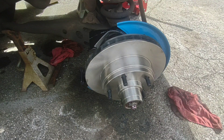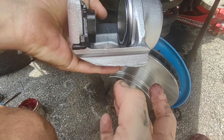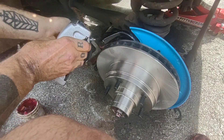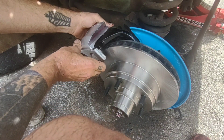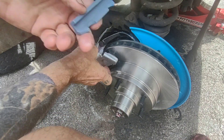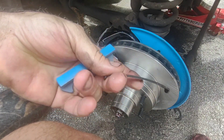What I like to do is put the wheel on, jack it up, and set my bearing — I usually like to get one and a half spins out of it, then set the bearing, put my retainer on, and put my cotter pin in. Another thing you want to do before you put your calipers back on: put a super light coat of grease on the slide areas. Now the juggling act ensues — I've already got my back pad on with the anti-rattle clip at the bottom. Go ahead and slip this in, push it in at the top, bring the bottom in, and get the lower slide and bolt in.